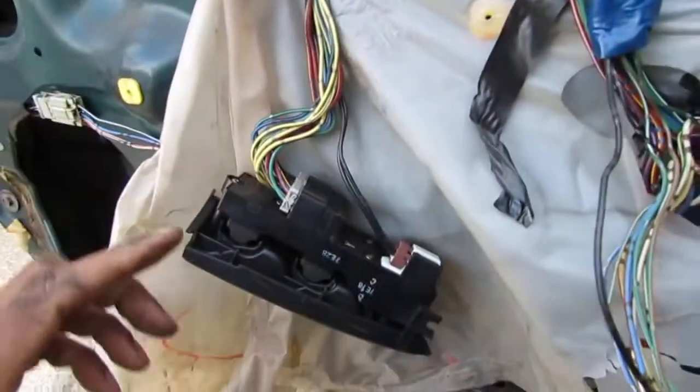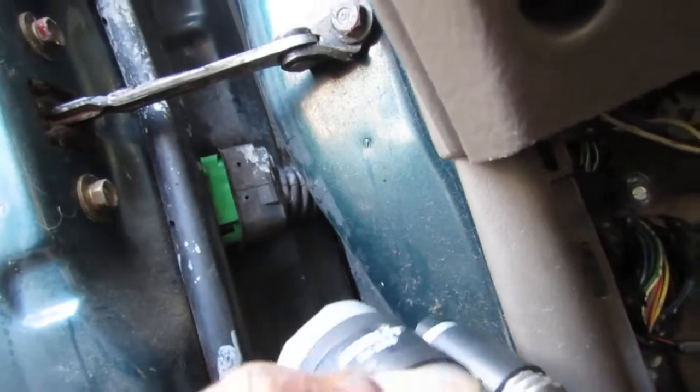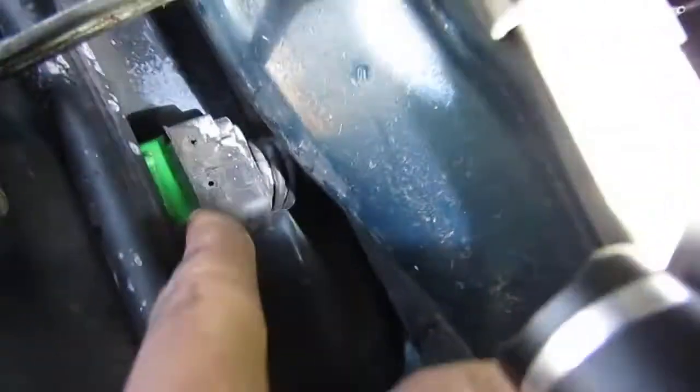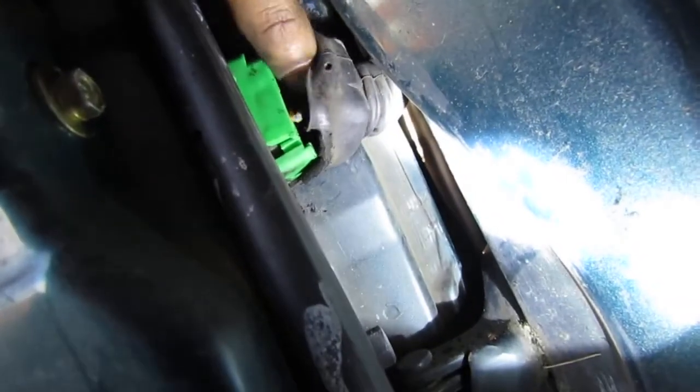So you can kind of speed up how fast we're gonna solve this problem, right? You know that this stuff doesn't move, so why would it break if it's not moving, right? But that moves, right? Because that moves, let's take a look in here. We'll see what I see. So, peel that back. Do you see it? Right there. That wire is broken.